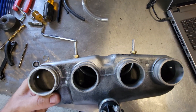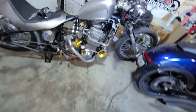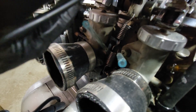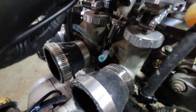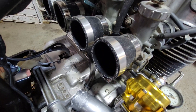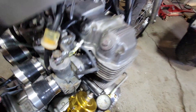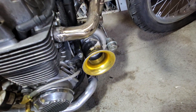The pitot tubes come out the top, and the tubes will connect here on the top, which come out of the float bowls right about there. The boost will go into the float bowls and actually push the fuel out of the carburetor — it's not the air coming in. The Venturi effect goes away. Mr. Venturi leaves the party, and Mr. Turbo starts his game.